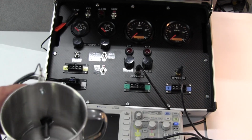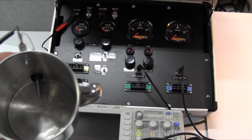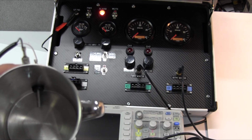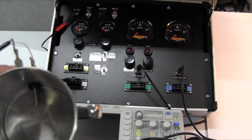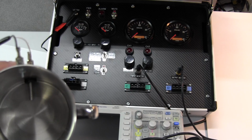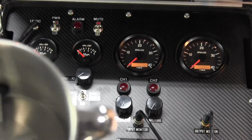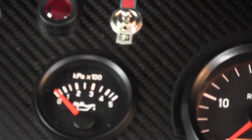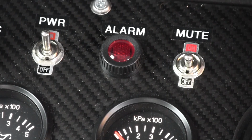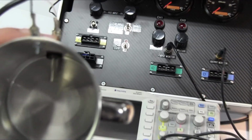The Bolec WL601 will sound an alarm if the coolant level falls below the coolant level probe. The signal that goes to the coolant level probe is AC, or alternating current. This prevents electrolysis and a material buildup on the probe. In this demonstration, the WL601 Bolec low water level alarm has included a 7-second slosh delay, so if you are driving around a winding mountain road there will be no false alarms.